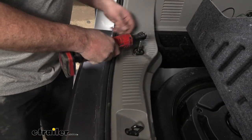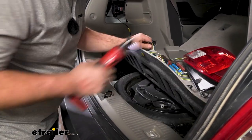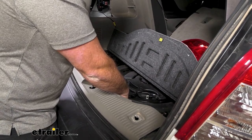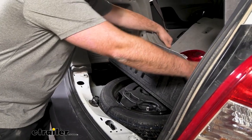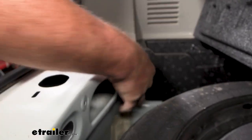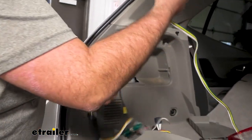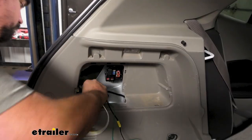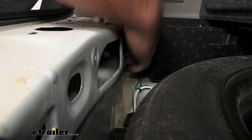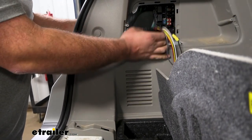I found a way to pass this through without having to pull any of this plastic off, which should make it a little easier. You'll see these little tie-down hooks, or cargo hooks — go ahead and remove those, they're going to be a 10 millimeter. Scuff panels generally have clips just like the rest of our interior panels, so pry up on each side and then work your way to the middle. Once that pops off, you're going to see there's a pocket behind this styrofoam that will allow us to get our wires passed through and tuck them under. I'll get my passenger side wire as well as our four-pole wiring routed over.